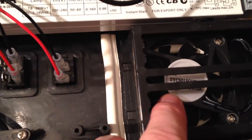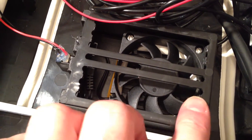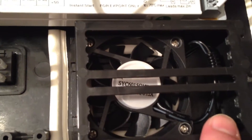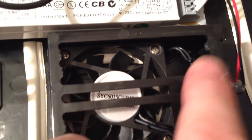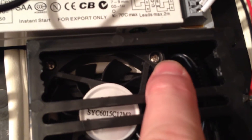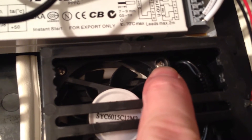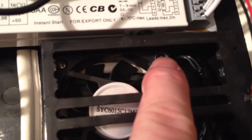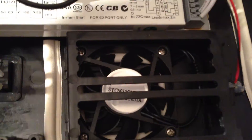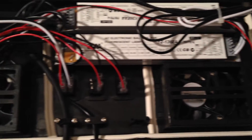What I've done is taken both fans out and used rubber material sandwiched between the fan and the plastic door it fits to, as a bit of dampening. On one side I've taken the fan out, swapped it over - and you find the screws don't go in because the hole is only recessed on one side. So I drilled a fraction bigger than the screw head, just four or five millimeters deep, just enough to recess the hole to allow the screw head through and into the original holes. Now we've got air being sucked in one side and blown out the other.